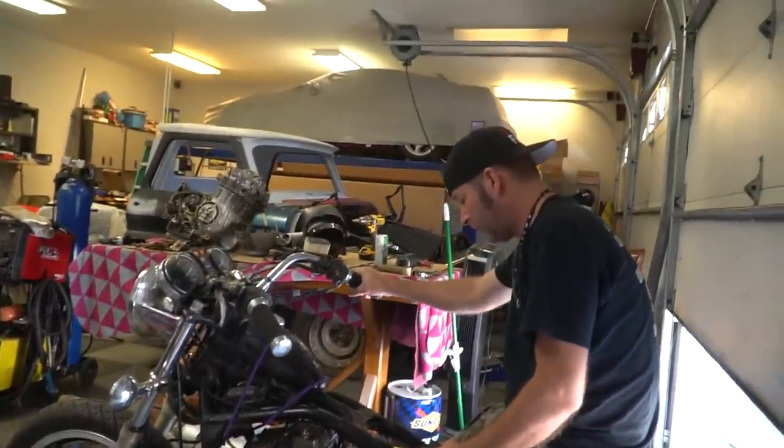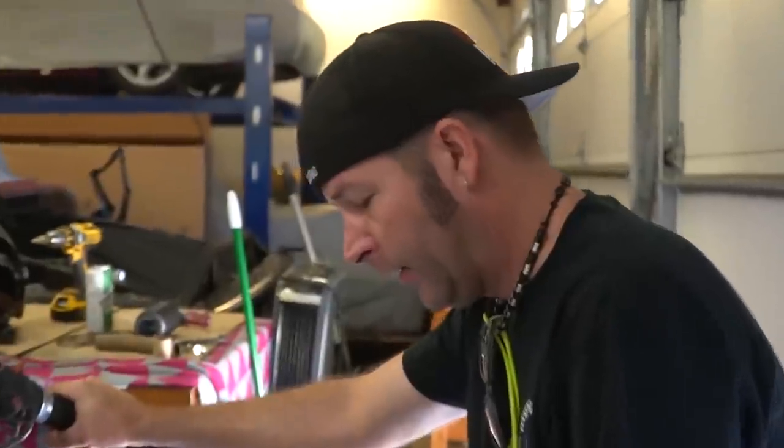Not fixed — same issue as before. I don't think it's the carburetor. We just need to wait until we get this valve cover gasket in, and then hopefully we can check the timing somehow and check the exhaust for restrictions. I really like the sound of this bike — it sounds mean idling, up to about four grand, and then it just falls on its face. You can tell it's going to have some power.